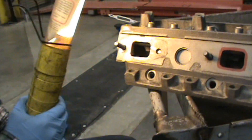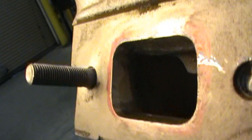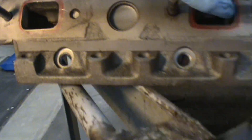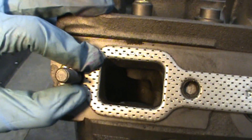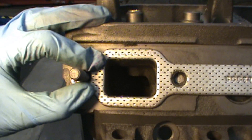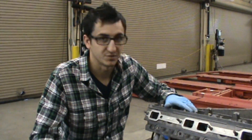Alright, we're finished up with this port. You can see we've taken out a good amount of material and it's pretty much flush. You can come in with a single bit piece and clean it up a little more, but since it's the exhaust port we don't really need to do that. We're going to put our gasket on just to make sure the job is complete, and when we center the gasket, you can see we now have a perfectly flushed port with no red spots sticking out. This port is all finished up. After we finish all of them, we'll throw it on the airflow bench and show you how to use that to see how much better she does. This has been another video from DIY Auto Tech — see you next time.